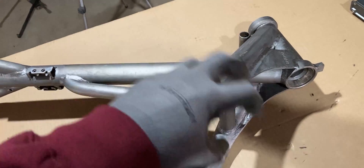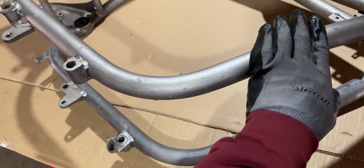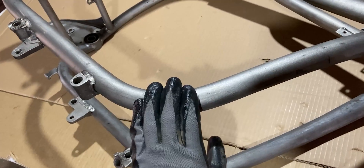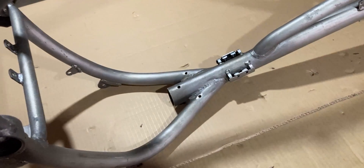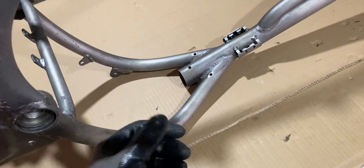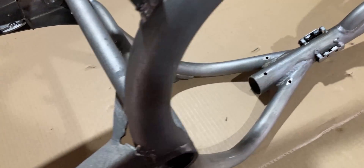Towards the front it's very intricate, but I was able to shoot in all directions and get everything cleaned up. The laser cleaning machine does not damage the metal itself — it only cleans what is on top of the surface, which is a very big advantage. Media blasting does harm the surface, so for a motorcycle frame laser cleaning is the better choice. The frame wasn't actually in bad condition, but since I'm restoring it I want to give it a good coating of primer and paint to prolong the lifetime of this frame. It's in very good condition even towards the bottom where I saw rock chips — just a couple of little dents, nothing too serious. This frame will last another 50 years hopefully.